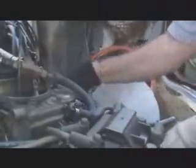Okay, I'm just going to throw these things back on here dry. Just going to lay them on there and put the valve covers on. The bolts are a little bit of a problem getting the bolts through because they're shorter. So it's been a little bit of a challenge to get the bolts started here with these thicker gaskets. And I'm using these extra washers on them here to help spread the pressure down on the pan rail. I got this really big one here that I'm using on the back one that was most prone to leaking.